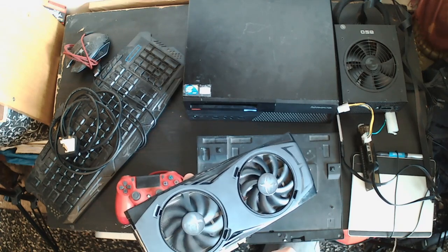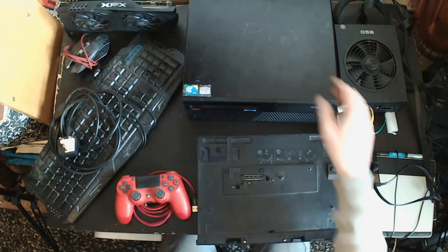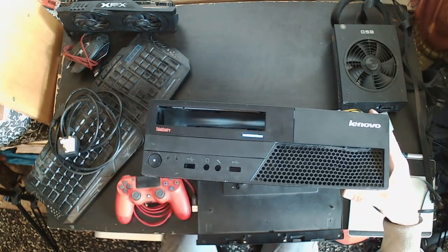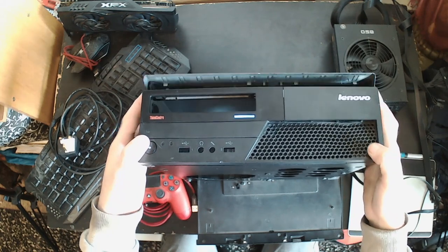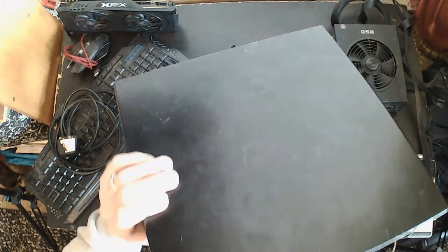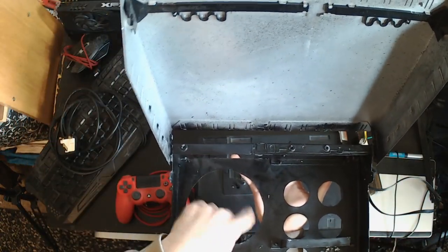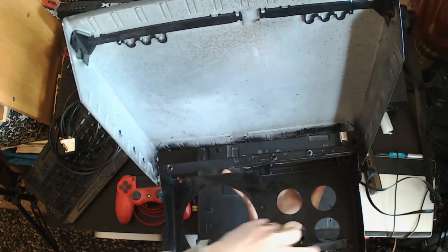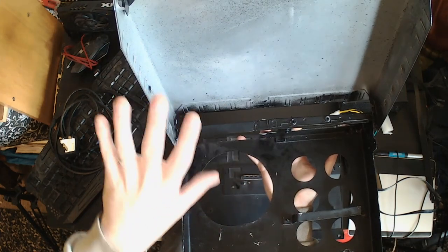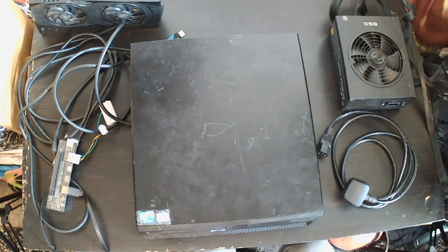This is what we're going to use for our eGPU setup today. It's an absolute monster of a card. You could use a 580 as well — all the AMD cards are really compatible with eGPU setups and they're quite popular on Mac as well. I also took this old Core 2 Duo Lenovo ThinkCentre M58P — it didn't work, so me and my father 'Tech Dad' gutted it, resprayed it, drilled holes for power supply cooling and graphics card cooling, and added a little bracket. This creates a neat enclosure for the eGPU on the desk.